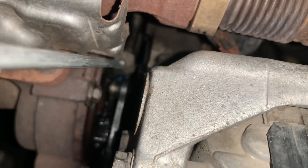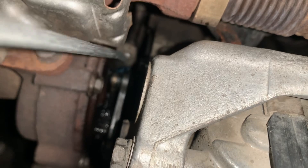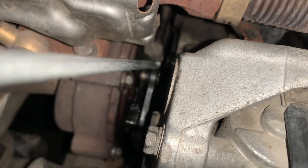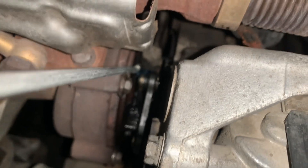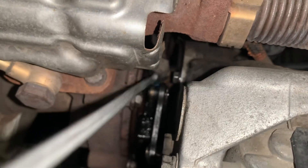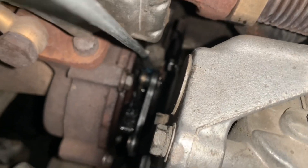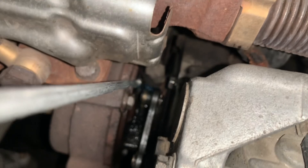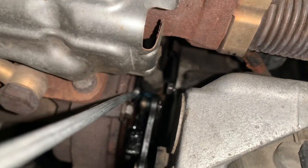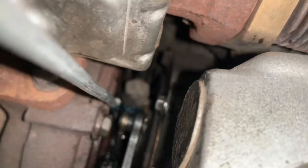This is the inlet pipe of the engine oil for lubricating the bearing of the turbocharger. These turbochargers are designed to last the lifetime of the vehicle, and most turbocharger failures are due to bearing failure, which is basically caused by lack of lubrication. If you use a thicker engine oil like 20w40, it will be difficult for the pump to deliver oil up to this point, so you must always use the correct grade — 5w40, or maybe 0w40 if you are living in a very cold region.